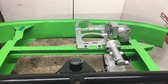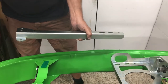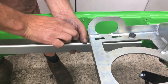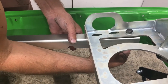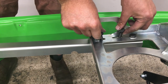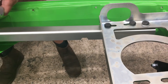Sean's going to fit the crossmember here, just to explain the difference in chassis, but the procedure is the same with both types. Drop an M10 by 25 screw in there with a washer on both sides — once again we're using ordinary nuts, but in the kit you'll get lock nuts. Drop two M10 bolts in those slots and push them to the extreme ends. That puts the channel itself in a parallel straight line to the other bracket.